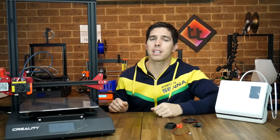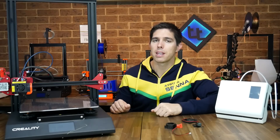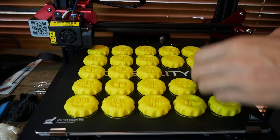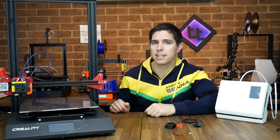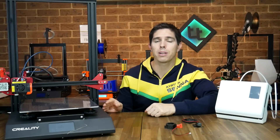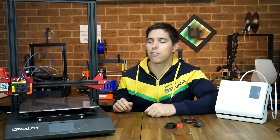Now I can't promise that it's going to work the same for you, but hopefully it's going to help a number of people. Next problem for me is the print bed — and the problem is that it sticks too well. Anytime you have to hack at it that hard with a scraper, it becomes inherently dangerous. Comments in my previous videos said if you heat up the heated bed after the print is finished, it does soften and comes off a little bit easier, and I tried that and it was definitely easier. But for me, this printer is so nice that it deserved a better solution.